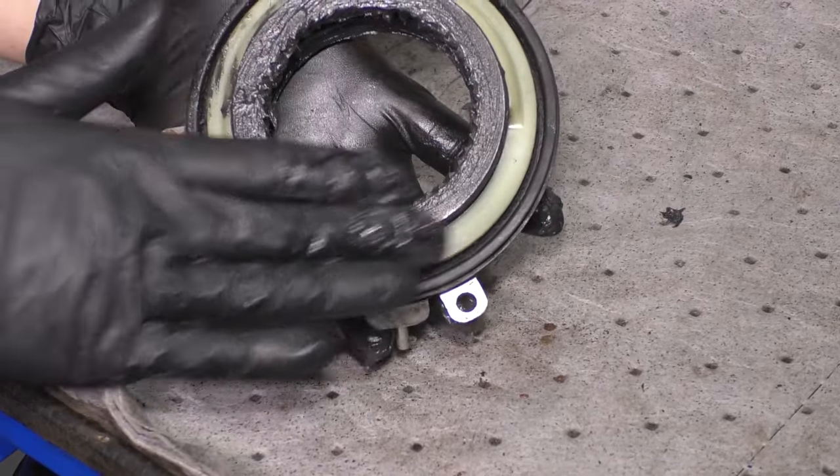If you are reusing your old rotor, make sure you clean up the inside of the rotor too — you can see the two rust ridges where the hub was riding. Sand these down and make sure they're nice and flat. I'm actually using a new rotor, but the procedure is the same whether you're using old or new brakes. Take your rotor and slide it over, then put a lug nut on to hold the rotor in place so it doesn't flop around. This makes caliper installation easier and prevents rust chunks from falling in and tilting the rotor off the flat surface you just cleaned.